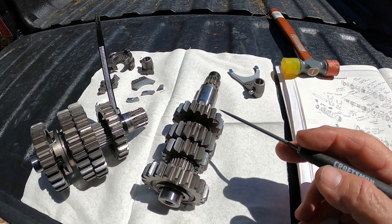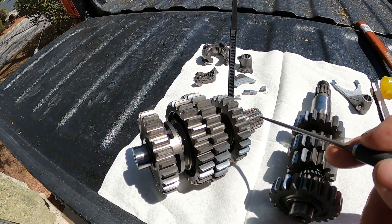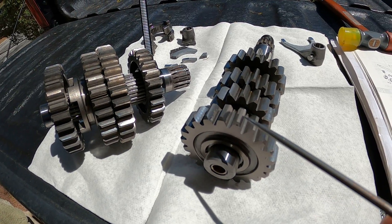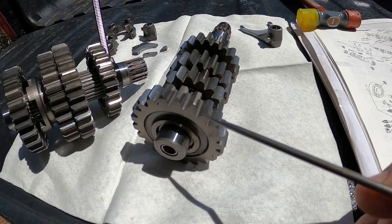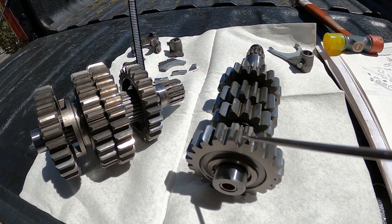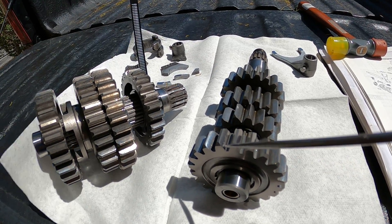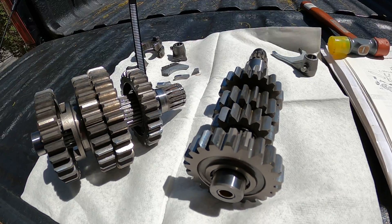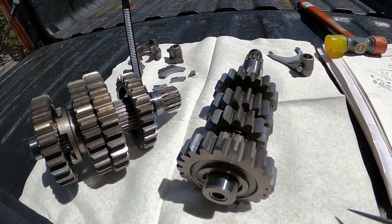This is what's called the drive. These are what's called the driven gears. So on fourth gear here, that's this one right here. And I've got some stress pitting — that's not corrosion, that's not damage from parts going through, that's from stress. And there's a few spots along the fourth gear drive that are bad, so I'm going to replace that.